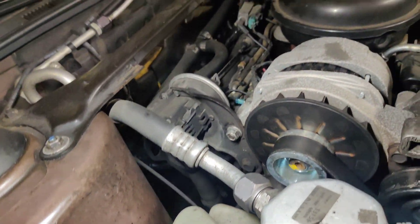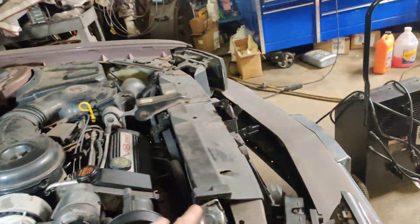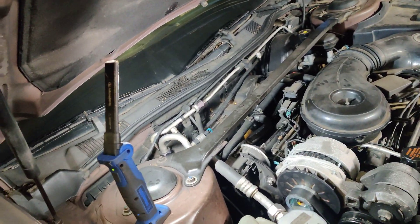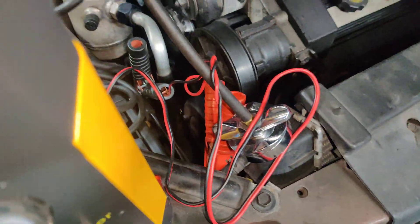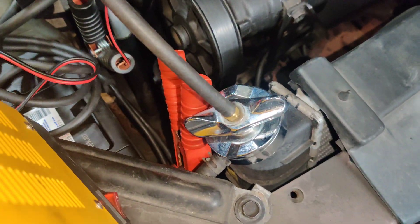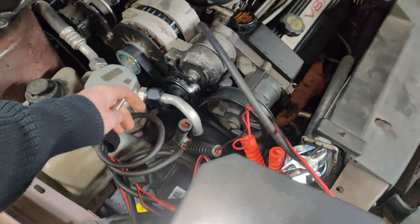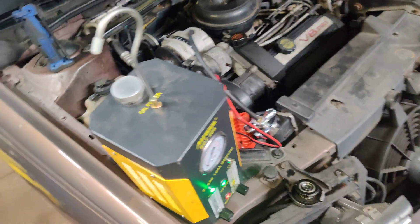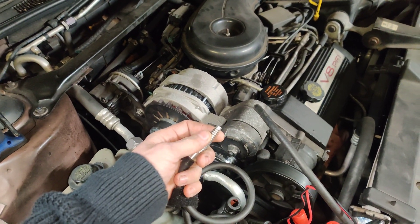So what I'm going to do is, we're going to try a little trick here. We're going to get my smoke machine and get it up to the cooling system, and then we'll see where the smoke comes out. I took my adapter from my coolant pressure testing kit, put it on there, took the end off, and now we're going to put the smoke machine in here. Let's build some smoke up first, and then we'll connect it up.